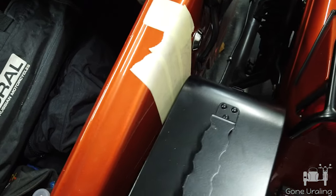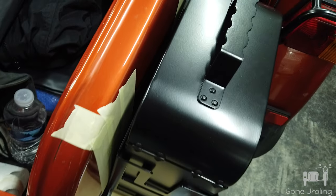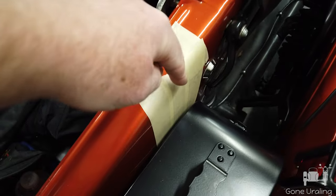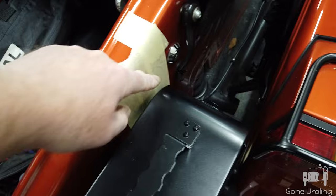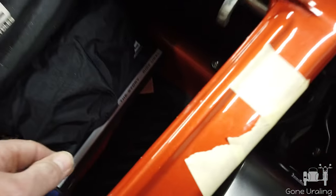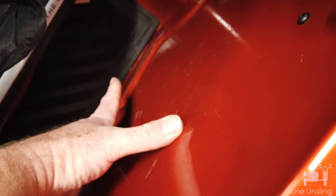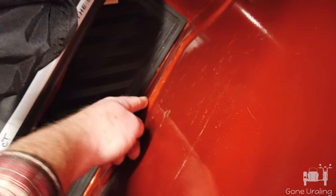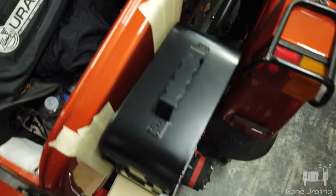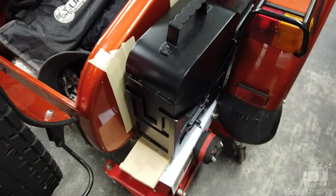About two fingers seems comfortable. This one is actually slightly further back than mine was mounted — about a quarter of an inch — primarily because of that snap there. You'll notice a little bit of gap over here; some of that pulls out as you tighten it down. I'm going to put a bushing on the bottom to space it out a little bit. On the inside, this inner plate here will need to be cut off, because the proper mount hole is actually down here under the crease.